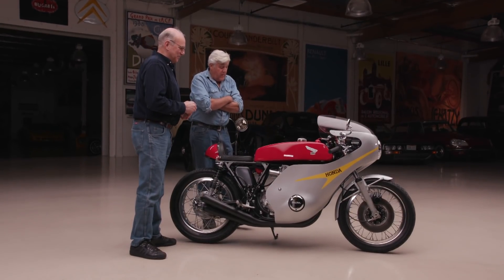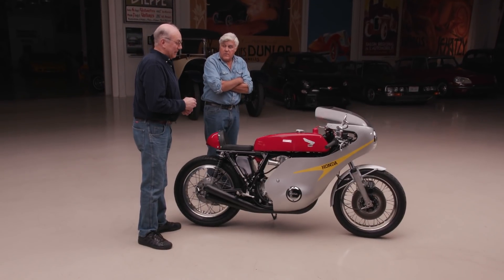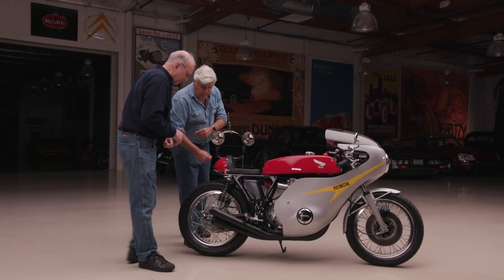You asked about my wife — she's very patient. She put up with all the evenings down there and doing without some other things to facilitate this. It turned out great, and you did most of the work yourself. The parts are really expensive, but I took everything apart, stripped everything, rebuilt everything, painted everything myself. I made a booth in my garage with 2x2s and plastic sheeting, with an exhaust fan and a door. The pipes are ceramic coated — powder coating doesn't stand up to the heat at the header end, but supposedly ceramic won't discolor.